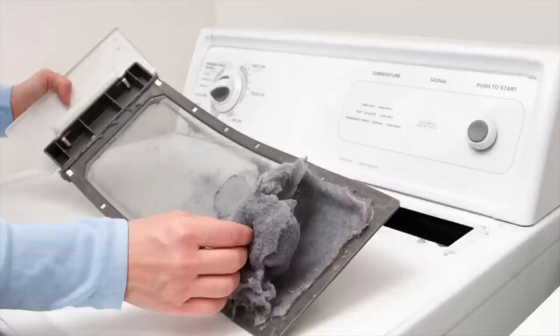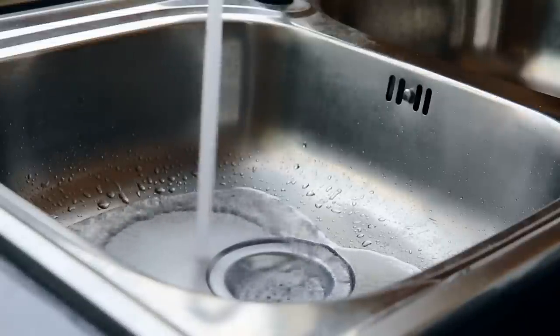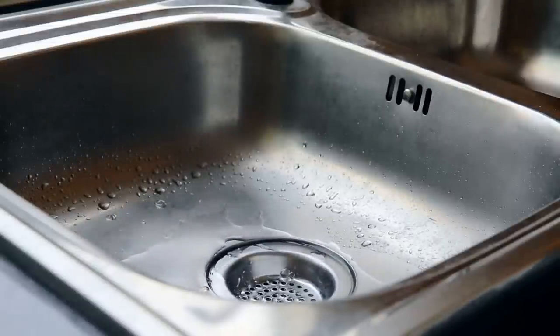You're slowly closing off the little tiny holes in the screen on your lint trap. You need to get that cleaned off once in a while. For the average family of four using dryer sheets every load, every other month take that lint trap to the kitchen sink, get a cheap dollar store plastic dish brush, and run hot water on it and scrub it gently on both sides to clean that wax off. If you suspect it's clogged, run cold water on it — the cold water won't go through because it's hydrophobic wax, and that's your dead giveaway it's time to clean it.